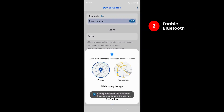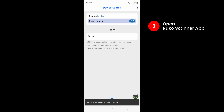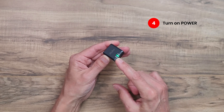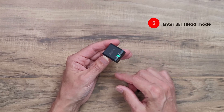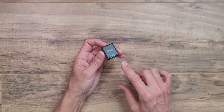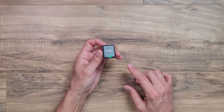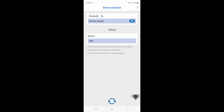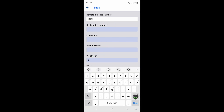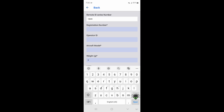Once the RUKO scanner app is loaded to your device, turn on Bluetooth, then open the app, then press the power button for three seconds to turn the module on. You'll see the lights flash letting you know it came on, then press and hold the settings button for three seconds as well. The lights will start to flash really fast. At this point the module should be connected to the app and the serial number of the device should show up underneath the device area, followed by the registration number box which is marked as required with an asterisk.